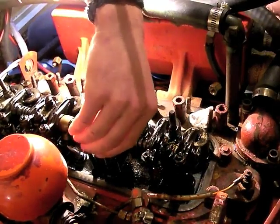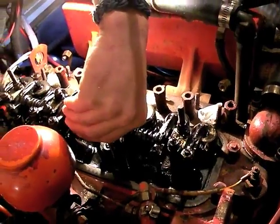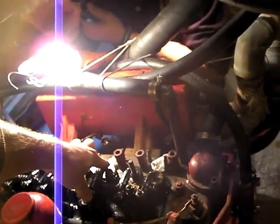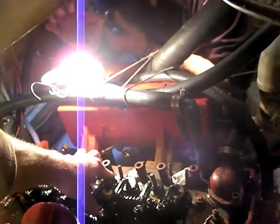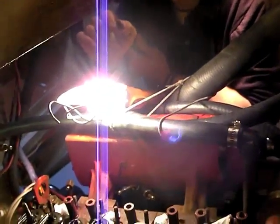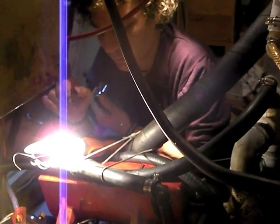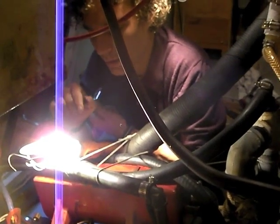Yeah, there's play in that one too. So that one's probably good too — they feel alright to me. The thing we were looking for, if there was going to be a problem, is if it wasn't tapping — it would have been something too tight. So if they all have clearance, then you probably aren't getting any compression problems from this.